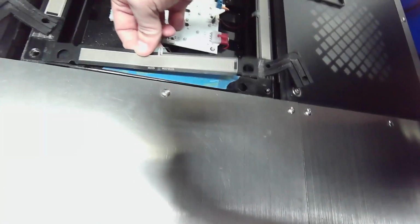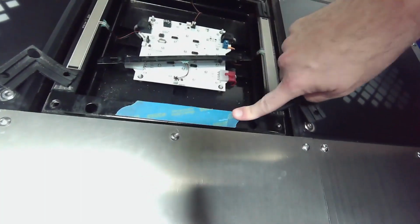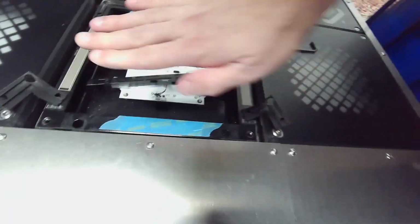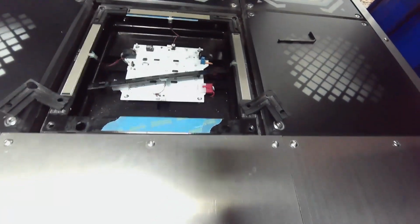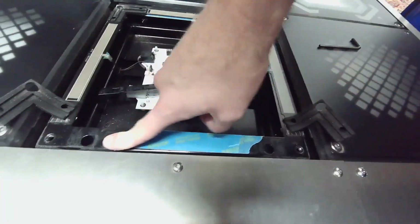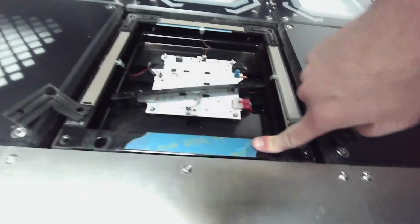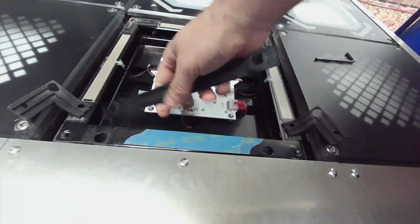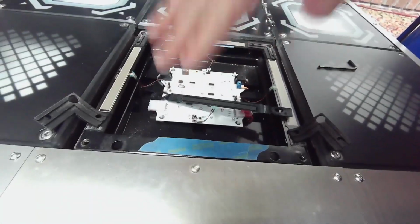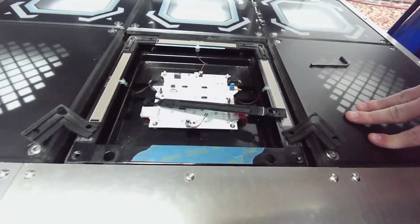the pad. So the first type of tape modding I'll be showing in the video is for under sensitivity if you want to increase the sensitivity of a given sensor. So first we've removed the corner grommets and then we carefully peel off the sensor, then use blue painter's tape or another extremely thin type of tape like this to put under the sensor to raise the sensor up just a tiny bit. You want to start with one or two pieces of tape because you don't want to make your pad oversensitive to the point where it starts ghosting.